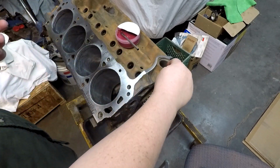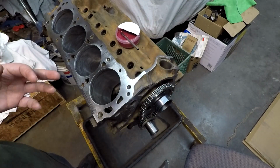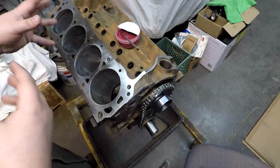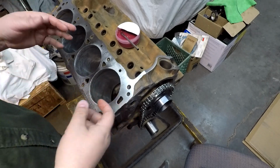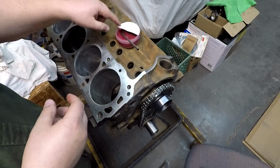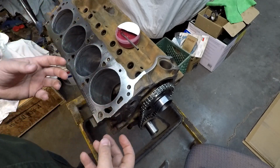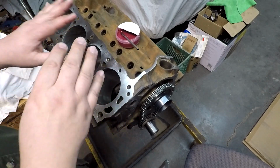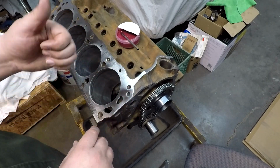Granted, yeah, we're going to put the shaft down here, put it on a drill, and go ahead and prime the system after we get the top end on it, oil pan on it, everything kind of buttoned up. We are going to prime it so everything wouldn't be dry anyways, but I like how this is staying clingy. It's not turning into a liquid, it's not running off, it's staying in its exact same state on the part, which is awesome.